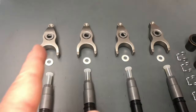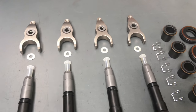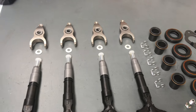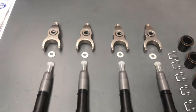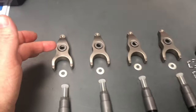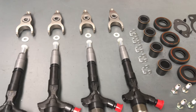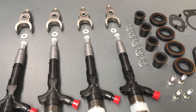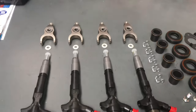Sometimes we've got an abundance of clamps in stock. The only reason they get replaced - back when they had the customer service exercise in 2015, one of the items on the parts list was replacing the injector clamps. I've never seen a problem with one. They're a cast piece of steel but maybe from over-tightening. Other workshops I've heard from have actually had broken clamps. So every now and then with those older ones, if we've got heaps in stock - which we have at the moment - anyone that purchases an injector kit for a 120 Prado or any of the earlier Hiluxes before mid-2009, if you just ask for them, you can get a free set of clamps and washers valued at about a hundred bucks.